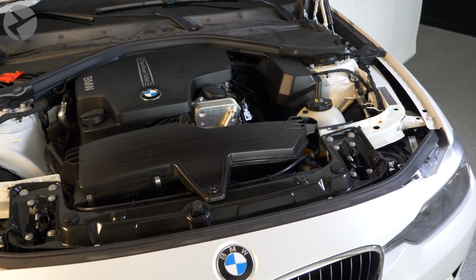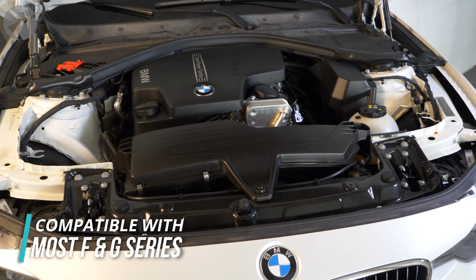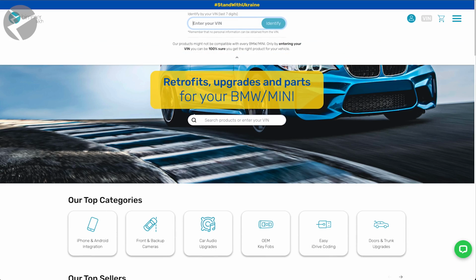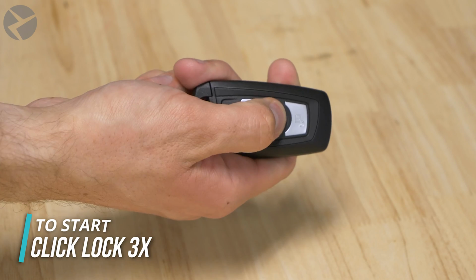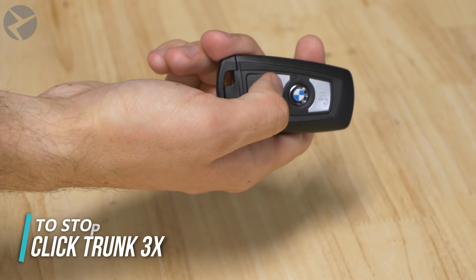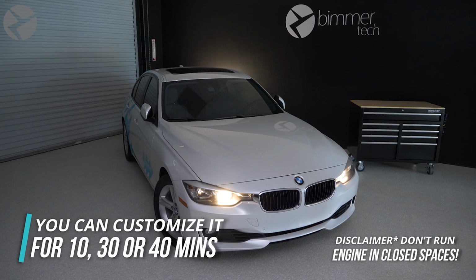After you get your remote start installed, you'll be able to take full advantage of what newer BMWs have. This is compatible with most F and G series BMWs produced after 2012. In order to check if your car is compatible, go to the product page and decode your VIN, link in the description. To start your BMW, simply hit the lock button on your key fob 3 times and it will start. To turn it off, hit the trunk button 3 times after the vehicle is running. If you don't turn it off, it will shut itself off after 20 minutes.